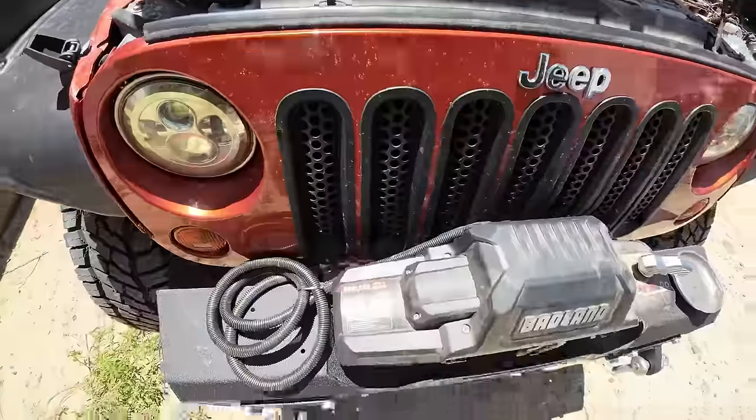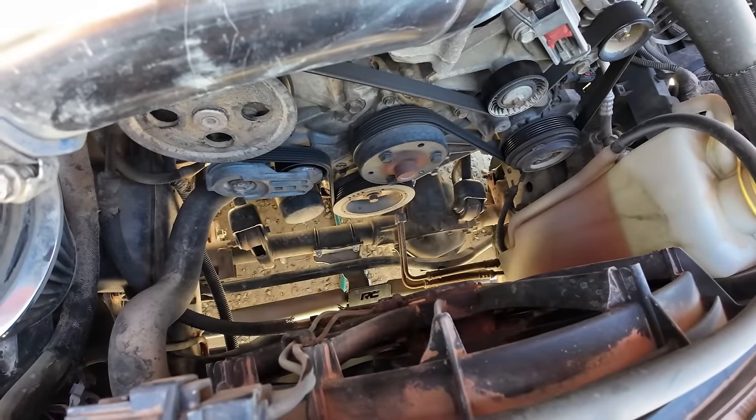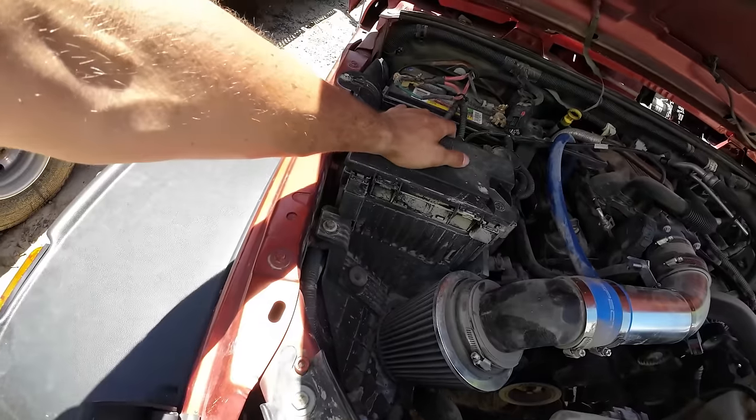It looks like we've got to wire it all the way up. I think we're going underneath the grill somehow, wiring it up — it's going to take a lot of zip ties, but we'll get there. Ian almost just learned a valuable lesson: on a lot of winch bumpers you have to put your fair lead on first and put your bolt in from this side, because there's not enough room for the nut.